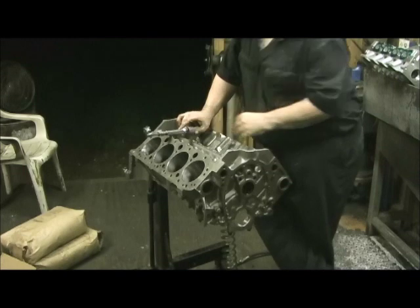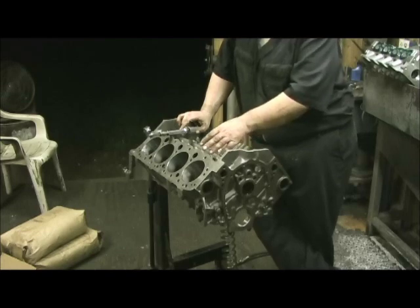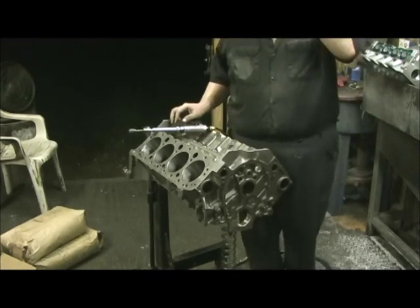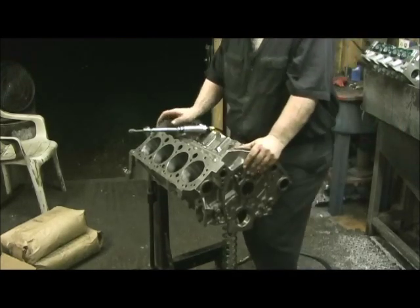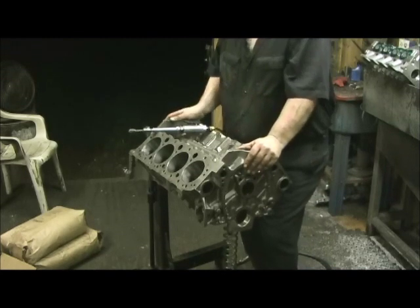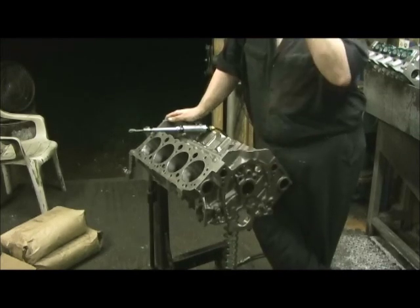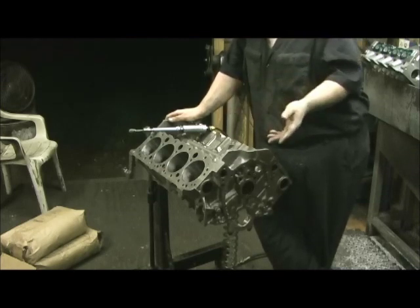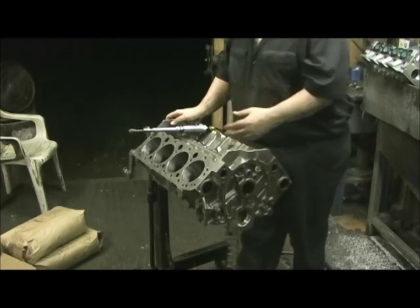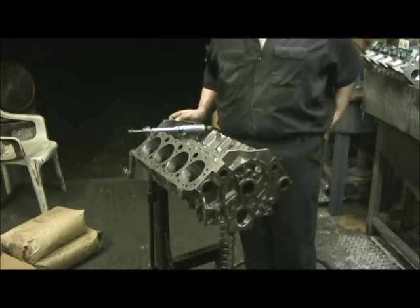So if there's any irregularities, it's going to be down to bare metal. There is probably more theoretical than anything else — if you go in here with your grinder and bring everything down to bare metal, then if there's any areas where there might be a light surface crack, this stops it. So there is actually a reason. Over the years I've never seen any of them busting or cracking as a result of not doing this. I'm not saying it's totally cosmetic. Number one: to show you all. Number two is the quick oil return, because going in here and blending it will bring the oil back to the pan super fast.